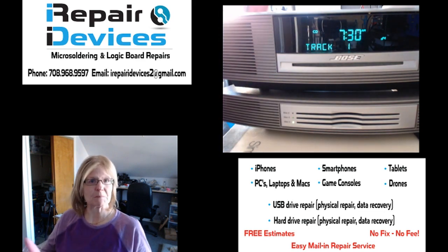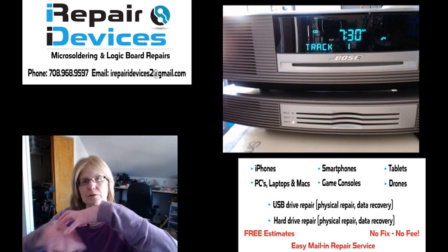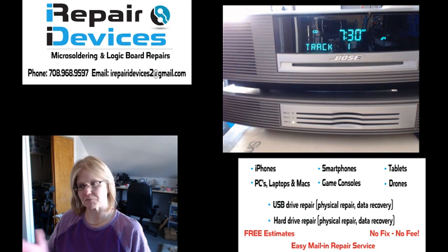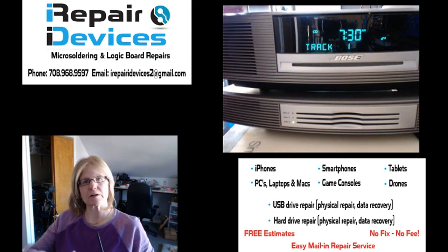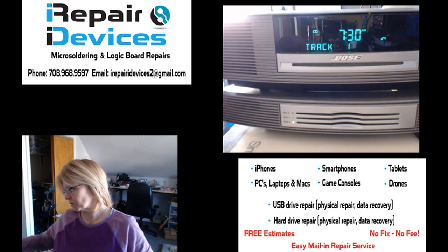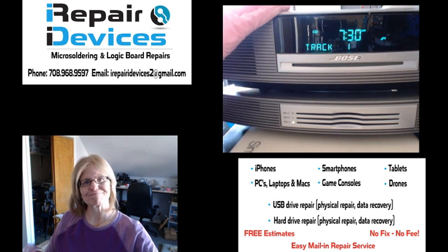And for the chattering, it makes sense as well — the CD assembly head wasn't making a good connection. So when the CD was spinning, it was chattering around in there, but it was enough to where it was still being held in place so the lens was able to say there's something in the slot and play the music. So this was a successful repair. All I need to do now is reassemble everything, put the screws back in, and contact the customer — they're going to be happy about this. Like and share my videos, and I hope you enjoy the rest of your day. Until next time. Bye.